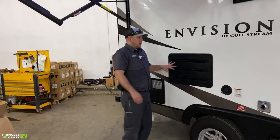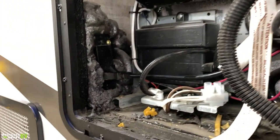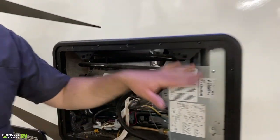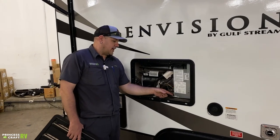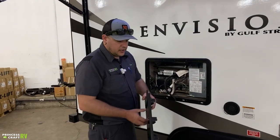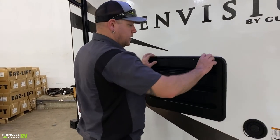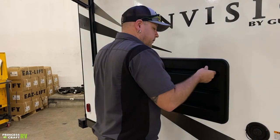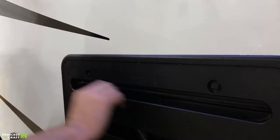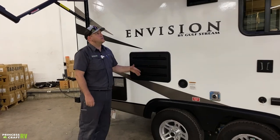Opening the Dometic refrigerator vent: pop off the cover. A few things to note — the 110 electric cord is on the left, and the control board is here if you're troubleshooting remotely. The burn chamber and LP gas side components are behind this cover, and there's a gas valve with a manual shutoff. This tube is a condensation drip tube — it's normal to occasionally see water drip out of it. To put the cover back, line up the four tabs on the bottom and snap the top into place. Turn and latch the fasteners — you can see the groove should run the length of the trailer. If you don't latch it, it will blow off while driving.